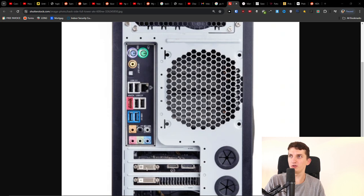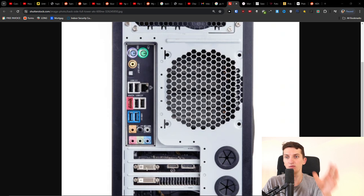Hey, I just want to make this quick video for you. If your HP monitor is not connecting to HDMI and you want to connect it to your PC, there are two things you can do. The first thing is to try changing the cable — you may have a faulty cable. If you have a different HDMI cable, use that and try a different one.